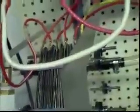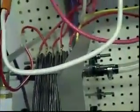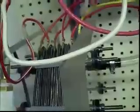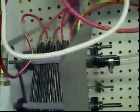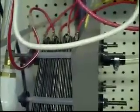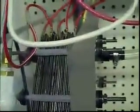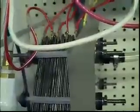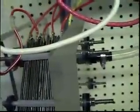If it's an alternator from a car, it's going to be about 13.8 volts. Same with the battery chargers that I use, they're a little higher than 12 volts. So when you know your power supplies in that range, you want to use the 5N configuration. That'll divide the voltage properly, so you'll get between 2 and 2.4 volts per plate gap. If you're using it straight off a charged battery, which gives you 12 volts or a little bit above, you want to go to a 4N configuration.